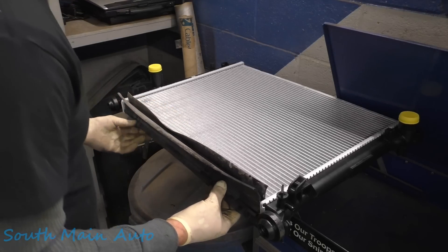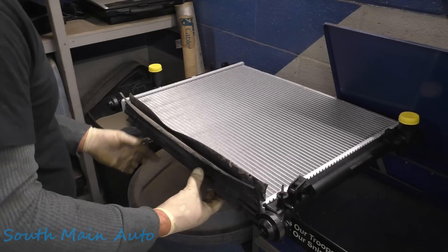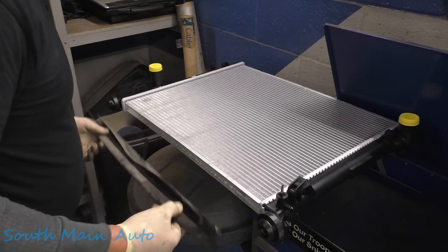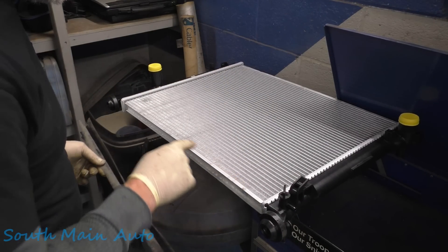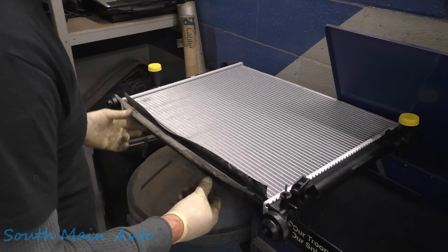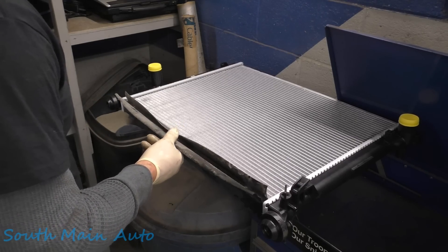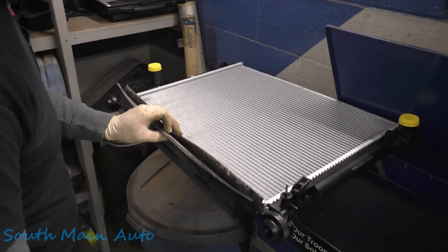This is the piece that was on the bottom of the radiator. The sucky part about aftermarket radiators is the — frickin friggity frigg holes. The thing that holds this on are little standouts in the aluminum on the OEM radiator. So you can stick it on here all day long, but it's not going to stay because aftermarket stuff is junk.